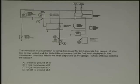What's the problem? Short to ground at W, high resistance at X, high resistance at Y, or short to ground at Z. So again, inaccurate fuel gauge. This is the level sensor. There's the fuel gauge. There's Z with the powertrain control module, X, W, and Y. And the PCM, the scan tool, is reading different than the gauge. Two different readings.